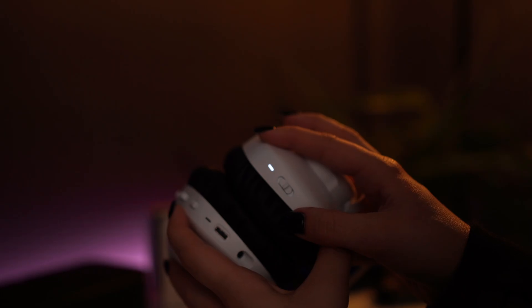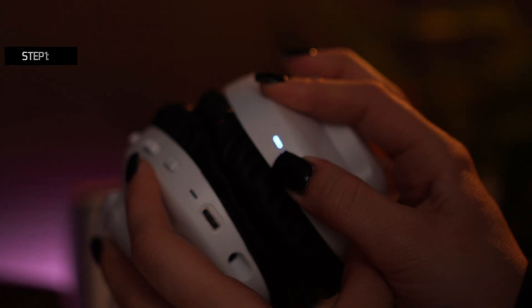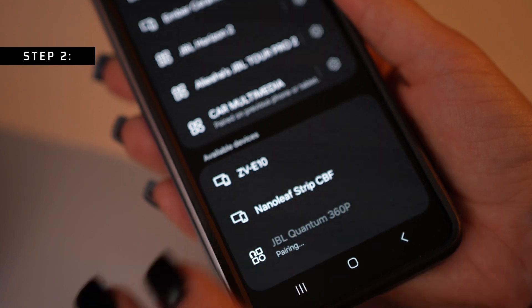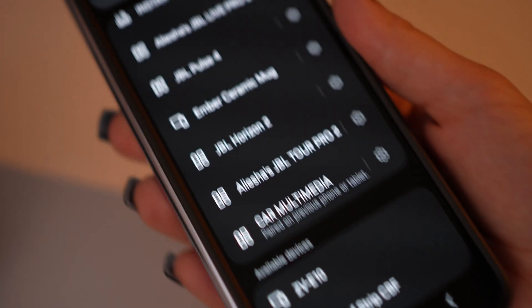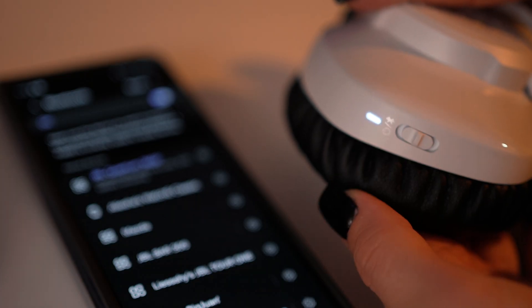That's all you need to do to get it working with your PlayStation, but if you want to get it to work with your PC or your phone, here are some more steps. To use this as a Bluetooth headset, Step 1: turn on the headset and press the power button forward and hold it in place until you hear the pairing noise. Step 2: the JBL Quantum 360p should appear in your Bluetooth devices to pair list, but if not, perform another Bluetooth scan to get it to appear. That's simply how Bluetooth works with this headset, just like any other pair of JBL headphones and earbuds.